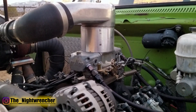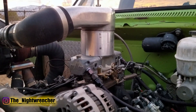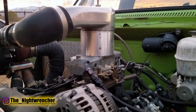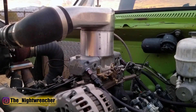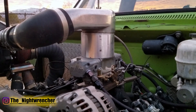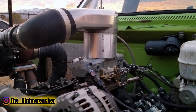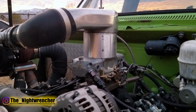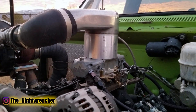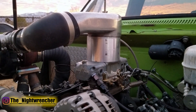The carburetor itself is also a special piece — you can't just run any off-the-shelf carburetor, it has to be designed to work with boost. This particular carburetor is an older Barry Grant alcohol 650 Demon that I've converted to gasoline, then to E85, and then to blow-through. If you want to build a carburetor for your own blow-through setup, you need to learn every single circuit on a 4150 style carburetor. If you're interested in what I did to make my carburetor work, go ahead and leave a comment below.